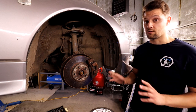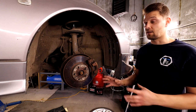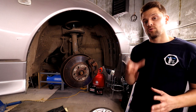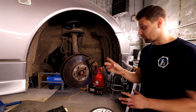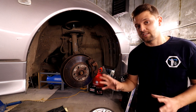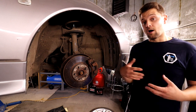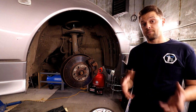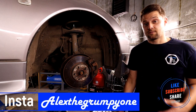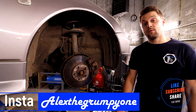Also if you've replaced the discs and pads, or just pads, be careful when you start driving - there's a bedding-in process where the pads bed in with the discs. After about 10 miles of using your brakes you'll see brake performance improve. Make sure you're very safe doing this job. I hope I covered pretty much everything - the next episode will be either restoring and painting the caliper or doing the rear brakes. Thanks for watching, stay safe, and I'll see you soon.